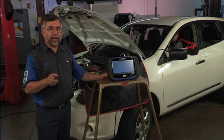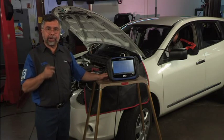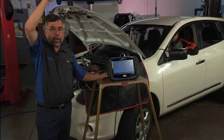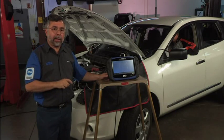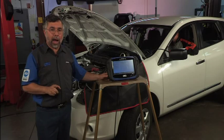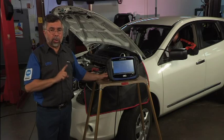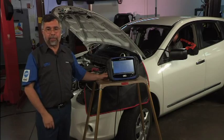Let's go over our scenario. I had good control of my injector with the change of throttle — input change to the controller was able to change output of the injector control. So I have fuel control, pulse width did change. We also noticed nothing wrong in mode 6 and we had no fault codes. However, when I went to check each coil — 4, 3, 2, and 1 — when I got to cylinder number 1 I had extreme high resistance, my voltage was higher than the other three. That tells me my problem may be coil and plug, or the plug itself. We also verified the injector wasn't at fault. So more than likely, since there was only one cylinder with this problem, my issue is related to either a bad plug or the coil itself.